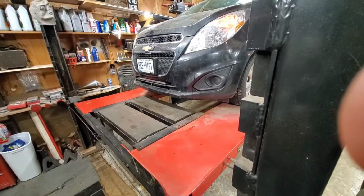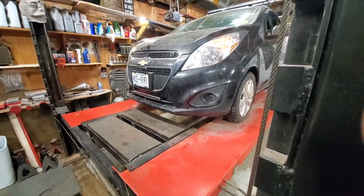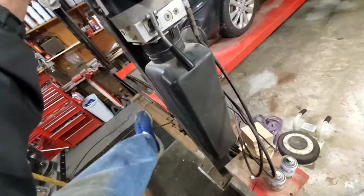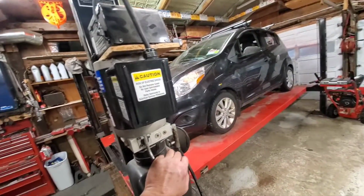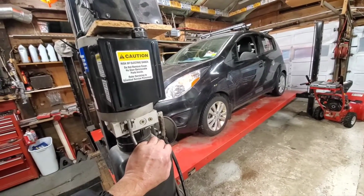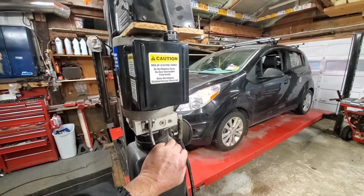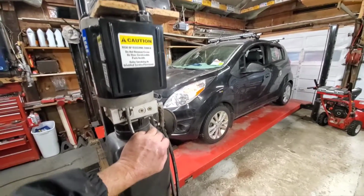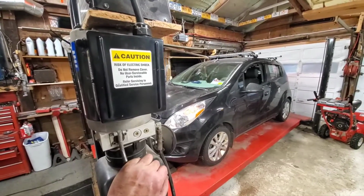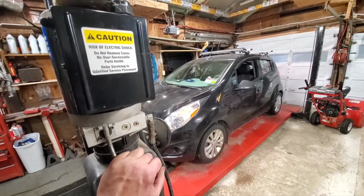And if that's good, I'm happy. And I'm really happy I changed the transmission fluid. I'm telling you guys, if you have a Nissan, a Jatco transmission, I don't know, CVT7 or some weird numbers, change your transmission fluid often. So I'm writing this fluid change down in the book, and then I'm going to change it at 10,000 miles again, because these are self-destructive transmissions. You ignore them, you're going to be paying the price. So unfortunately, that Chevy's a bunch of...